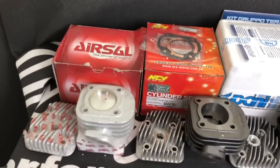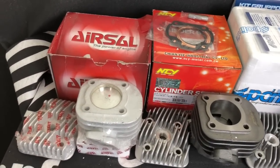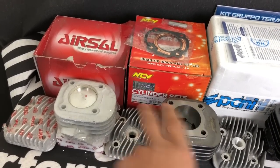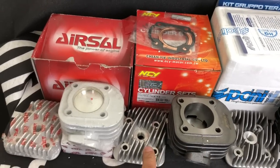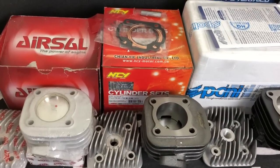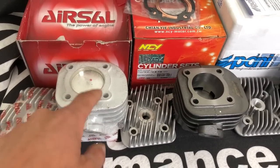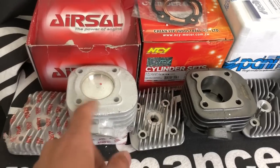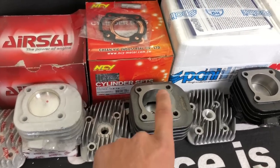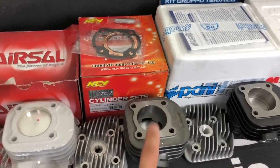If you're more budget-oriented and want something less expensive but reliable, these two kits are really good bang for your buck. These are all 70cc kits — cast iron, two-ring cylinders that come with head gaskets. Cast iron is nice because it can be rebuilt; you can bore and hone it. It's more susceptible to scratches since it doesn't have a Nicasil coating. Nicasil can't really be rebuilt — it's more costly than the cylinder itself to re-coat. Cast iron is my suggestion for beginners or people wanting something a bit more bulletproof.